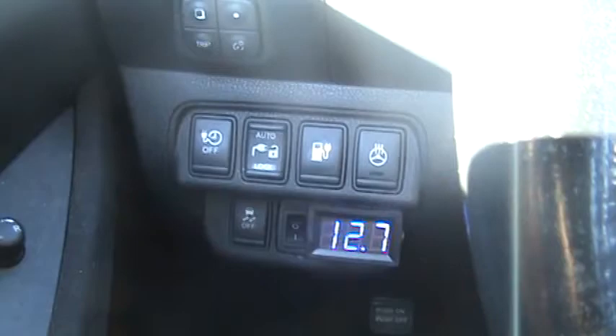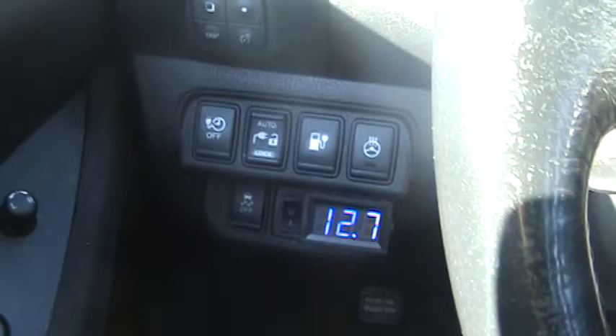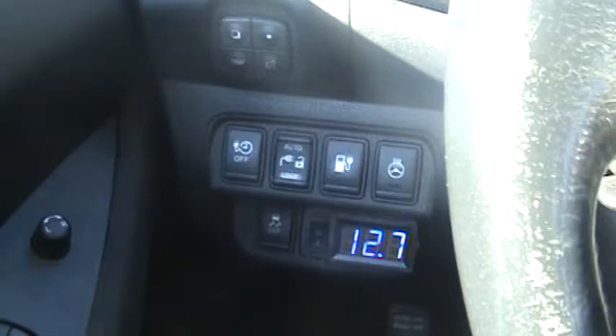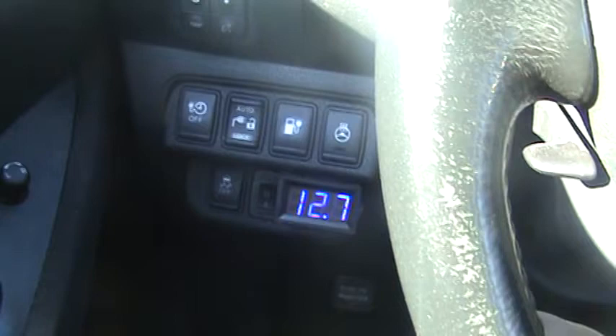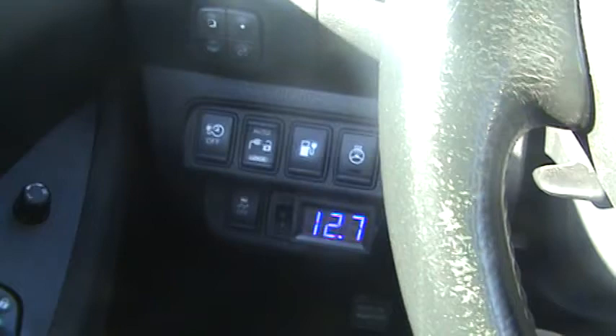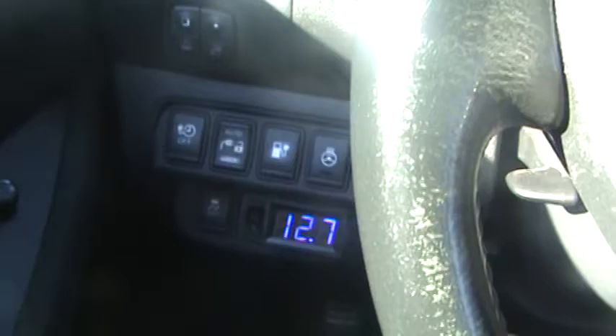The lead acid battery is only really good for a year or two and has to be replaced. That's one of the downfalls of this car. I wish Nissan would just make a 12 volt battery with their lithium ion pack and be done with it — or at least give you an option to flip a switch to send 12 volts from the big battery so you can start your car if the battery dies. Right now it can't charge the battery until the car is in the on position, but you can't get to the on position unless the 12 volt battery has enough charge.